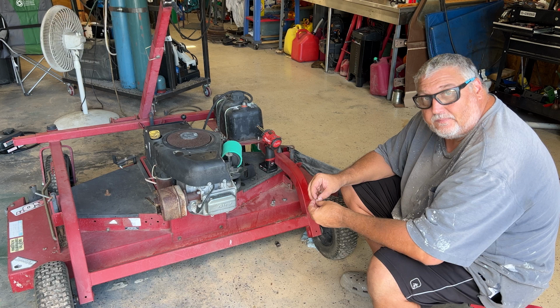Yes, Philip messed with it the following weekend. I think what he found was an original brand carb in the small engine parts bucket we have in the back. And I think he just cleaned and rebuilt that one. Maybe even ordered a new kit. I don't remember. After he got done working on that, whatever he did, it started right up, runs just normal. You don't put it on choke or anything. You can even lower the RPMs all the way down to the turtle before you turn it off.